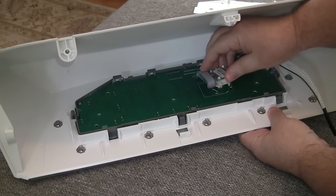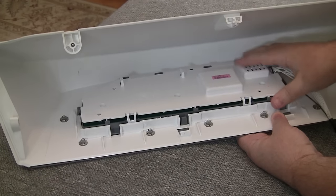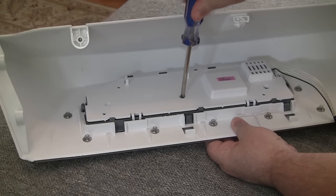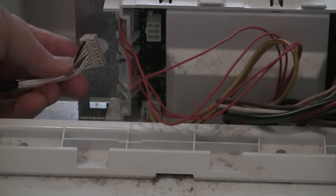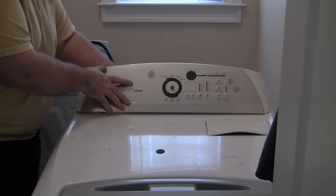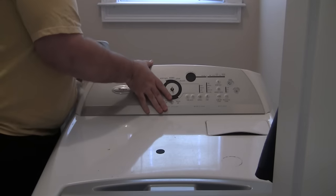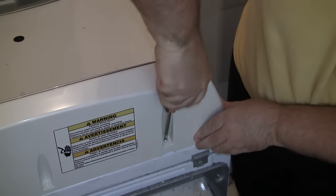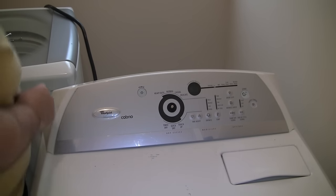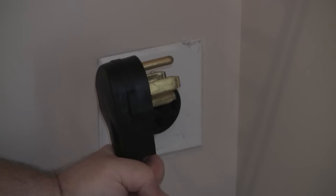Now it's just reversing the order of everything I did to remove the board earlier. I place the knob connector into the circuit board and turn a quarter turn clockwise, then snap the back plastic piece into place and finish by reinserting the three screws to securely fasten that back plastic protective cover. Plug the user control interface back into the control board to give everything power — it only fits in one way and only fits in one place. Put the user panel back into place by rolling it back over the control board and snapping it in place. Now tighten down the two screws that secure the user panel to the dryer. The last step of reassembly is to put the control panel knob back on — start with the dust washer and then the knob itself. The knob only goes on one way so you can't mess up the alignment. And now plug it back in.